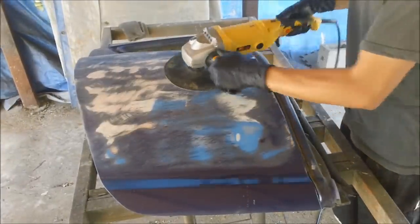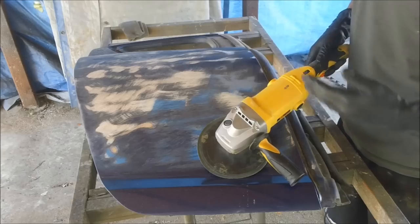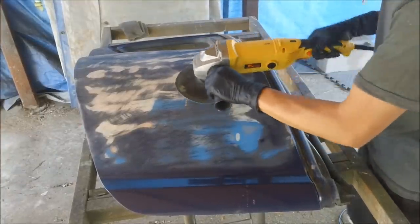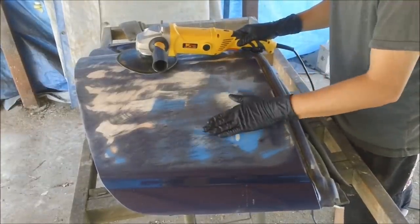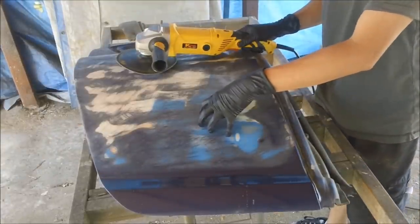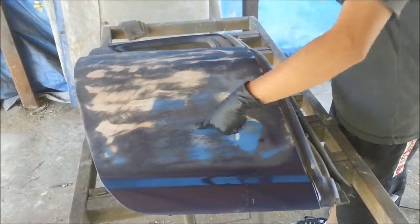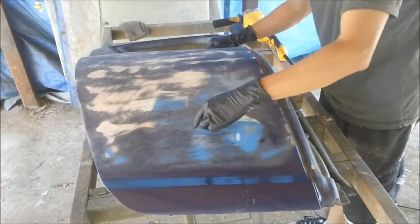You'll notice I wasn't keeping the buffer in one spot — I was moving around quite a bit. The reason is, just like buffing a panel, if you stay in one spot too long you'll burn it. Same principle here: if I stay too long in one spot I can heat up the metal enough to warp it. Already just by touching it, it's kind of warm — especially since this is off a 2004-2005 RX-8. These newer cars — I can already push the panel in; it's tin canning.